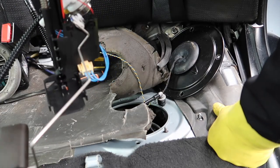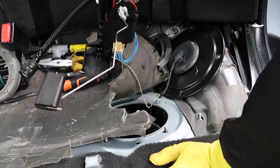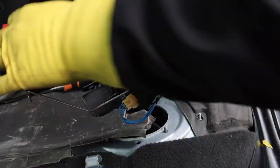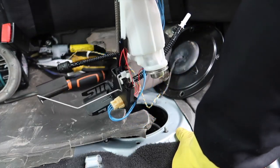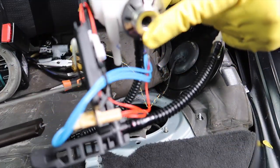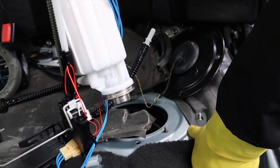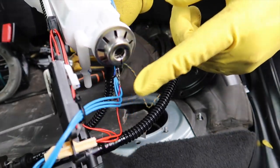Make sure all the vent hoses can vent and everything is correctly positioned. You can see the float — it moves correctly. This one goes on the top and the rest go on the bottom. Make sure you don't bend or twist all the wires — they only go in one way. There are three connectors: the fat one goes here, the other one clips on there, and the third connector goes there. You can't mix them up. And remember — it's not the sensor on the little wheel arch; this is the pressure regulator that sits on the filter itself on the M5s.